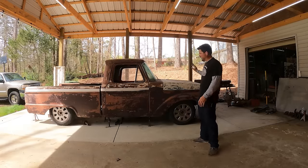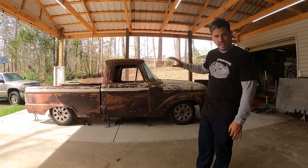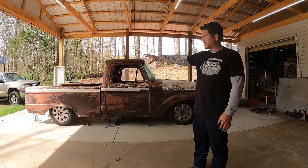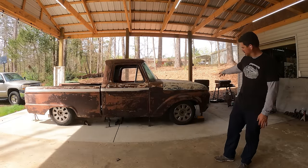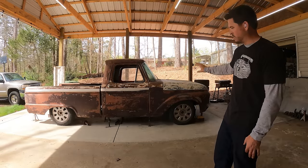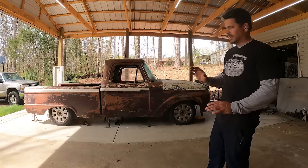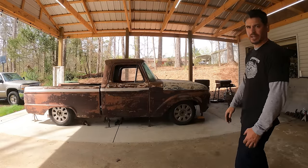All right, so everything has been fabricated to kind of join or graft my F100 into the existing Crown Vic firewall and floor pan. We've made the frame and brackets that bolt the bed of the truck to the Crown Vic frame. And we have supports for the front end off the front frame rails. And it's also bolted to the cab. Right now the jigs are still in place, so I'm curious, and you guys are gonna see it firsthand, once I jack up and take out these jigs, exactly how much it may cause the suspension to lower. And then, whatever stance we get, it's gonna drop it some more once we put the motor and transmission in. So, yeah.